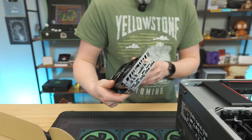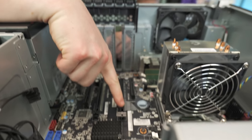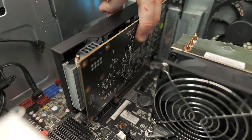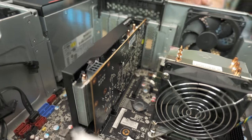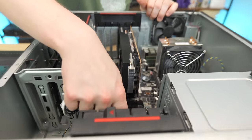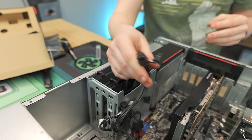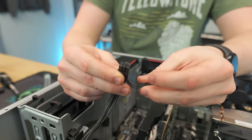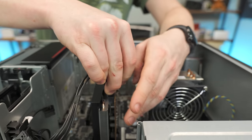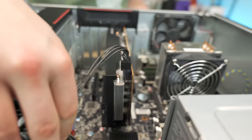Since this is a two-slot card, we're taking off two expansion slot covers. Line up the card with the PCIe slot and press down — that was a satisfying click. Close the retention bracket, and it feels solid — much better than some of those Optiplex systems. For power, we're going to unclip the connector from its little plastic hinge mechanism and use the 6+2 pin connector, making it into an 8-pin. Get the direction right, press it in, and make sure that extra pin is flush underneath. That's a nice, clean connection.